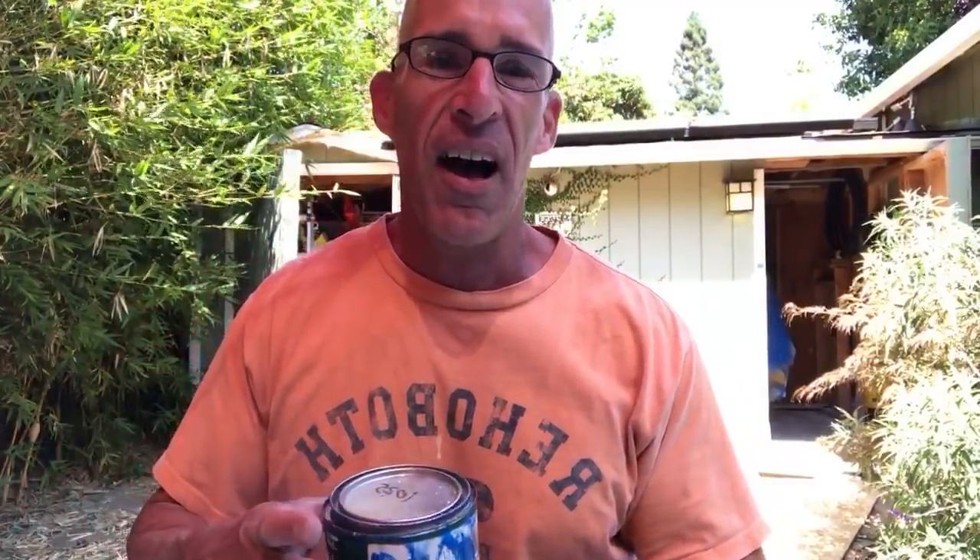Someone asked what I'm painting. It's best to use paint that is only for aircraft, and this is the kind I use — the Stitz Poly Fiber. This is a two-part epoxy finish that I'm using over the fiberglass. It's a different product over the fabric because the fabric is flexible; if you put normal paint over the fabric it will crack and get ugly.